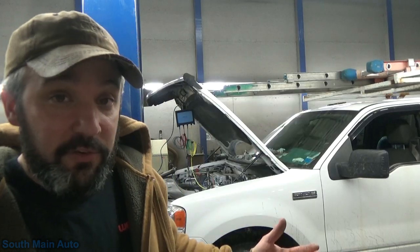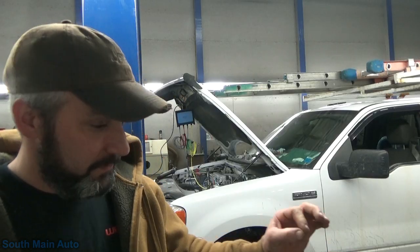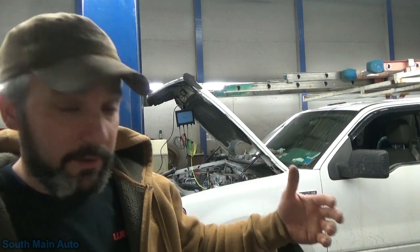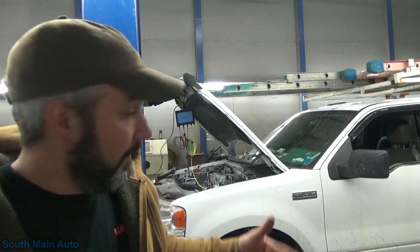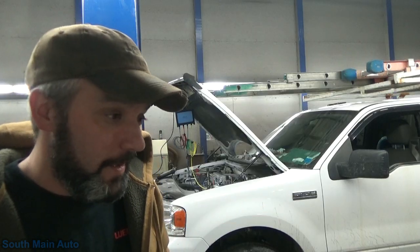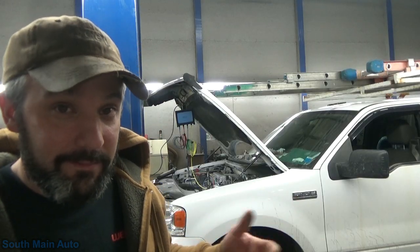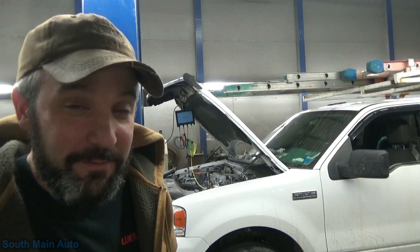So I thought, well, let's just pull one of those lines down. Test light to battery negative, stick it in there, takes the duty cycle control right away from it. Just boop, pops it right to the ground. Nothing. Rev the truck up a little bit, shut it off, start it up. Test light plugged in, nothing. Took the test light to battery 12 volts, ran both signals high, no codes. I don't know, maybe the ECM's confused.